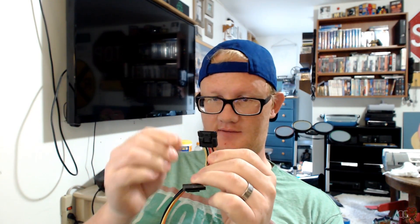A little research online shows that the SATA power connector has 15 pins. I also noticed looking at my power supply that there are only five different wires. How do five wires go to 15 pins? Well, several pins share the same voltage. There's 3.3V, 5V, and 12V that the cable carries. That actually makes sense because this same cable can supply power for 2.5-inch laptop drives, which take 5V — you can run those off a 5V USB port — but it can also supply power to 12V drives, the bigger 3.5-inch desktop hard drives.